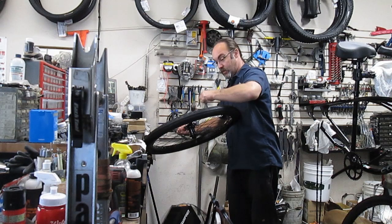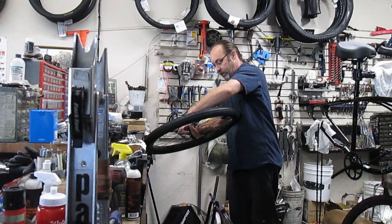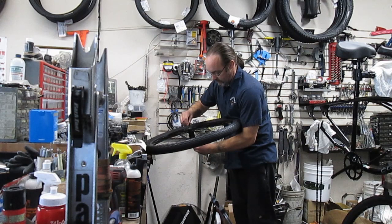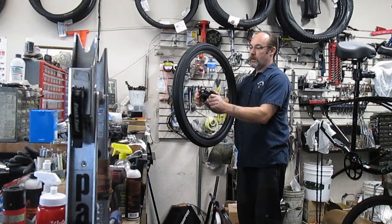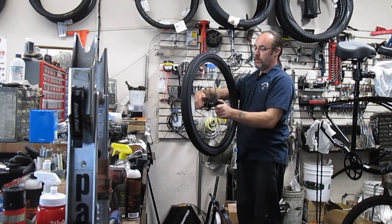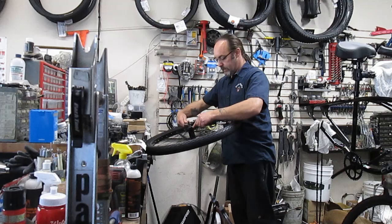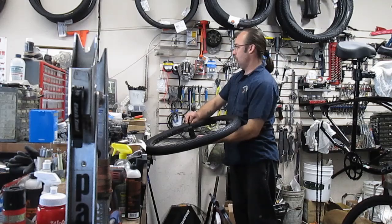Now what I'm going to do is try to see if I can hold that in place with my fingers on that side. And I'm going to use my palm to hold this wrench here at the same time. See if I can lock that down. Make sure there's no play. Let's see if it loosens it up a little bit. Oh, see how much nicer that thing rolls, dude? Way nicer. You don't want to loosen it too much because it does have to break in a little bit. Yeah, that was it. Just double check these two are locked together. Yep, it's locked. All right, so let's move on to the trimming.